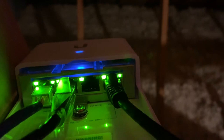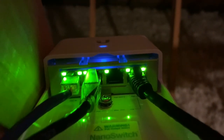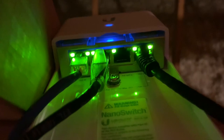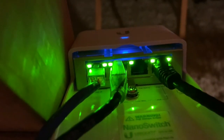All the POE is constantly powered on this, however it's not sending the signal that I need to turn on my POE camera right below us. As I was playing around in the basement, I couldn't get the Ubiquiti Switch 60-watt to turn this thing on and power it, because it was looking for an active signal, not a passive signal. I also thought this camera I had downstairs was going to run on passive as well, but it seems not to.